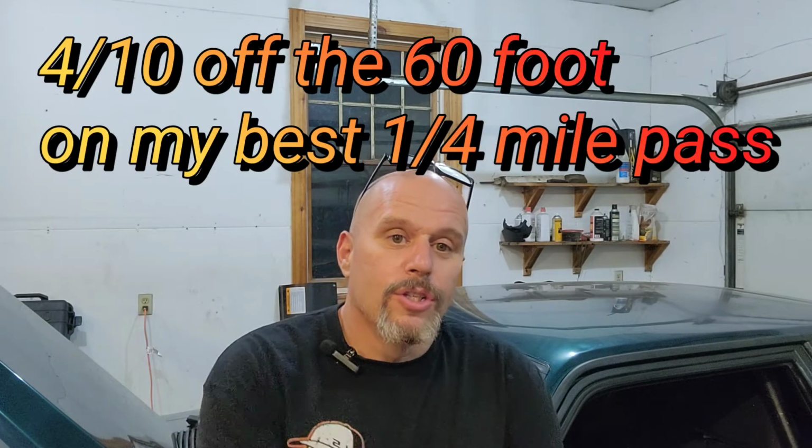But anyway, so I started doing some watching on YouTube and reading some old Yellow Bullet forums and figuring out what I wanted to do to try to get my instant center. I measured my instant center and anti-squat line, and on my anti-squat, I was at about 53, and it was way out in front of the car. It was low and long, which is good for a chassis car from what I've learned, but not good for a stock chassis car. So